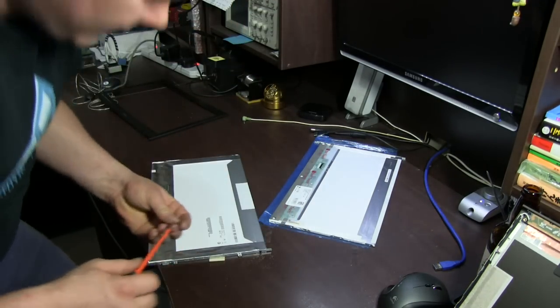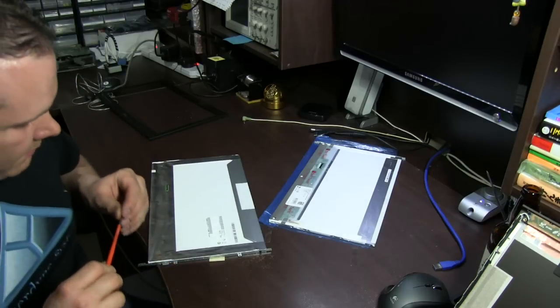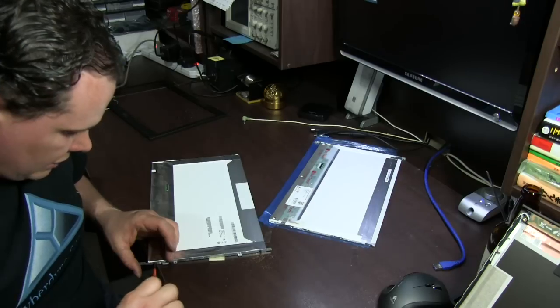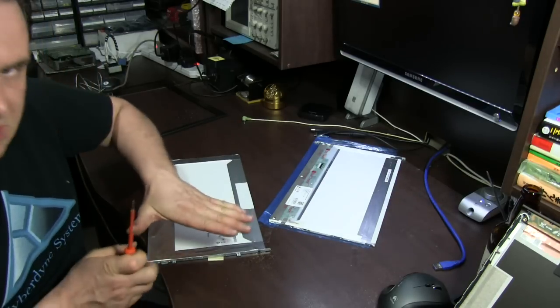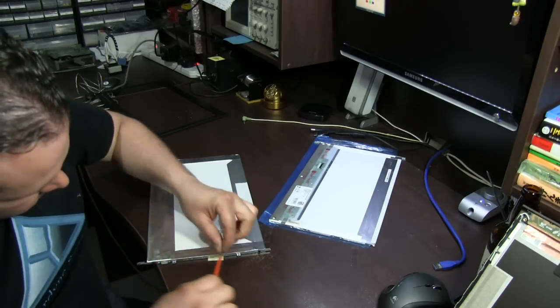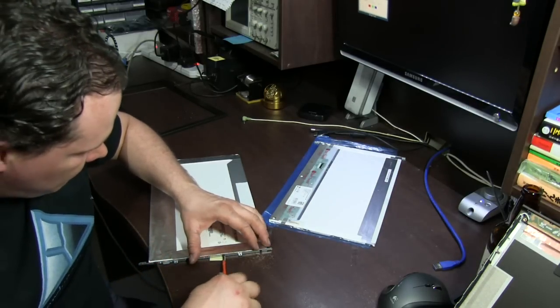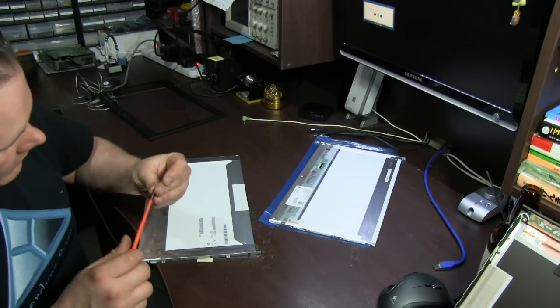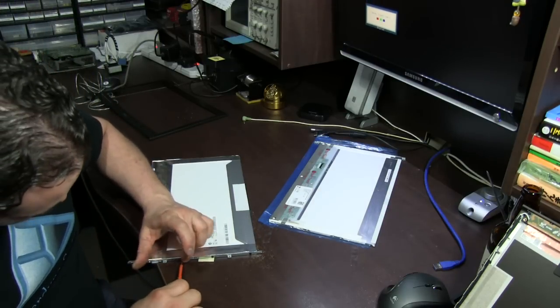So when I put the screws back in, I like to put them in but leave them about one turn loose. That way, as you put all the screws in, they all go in easily because the piece you're screwing down can move around a bit. Then once all the screws are in, I'll tighten them up. It just means that there's no strain on anything trying to work it in. Get the screw in there when it's slightly offset.